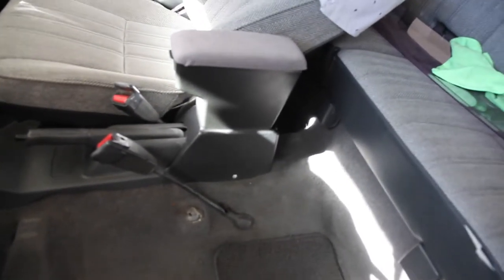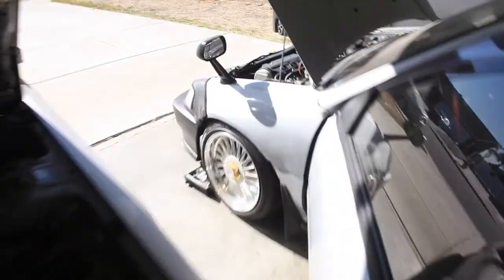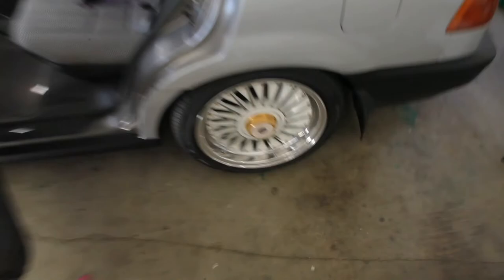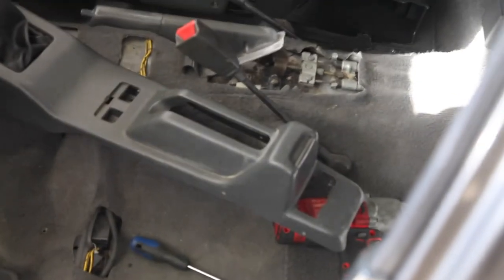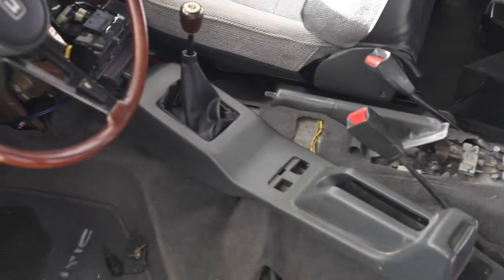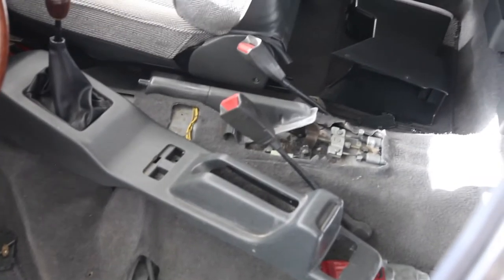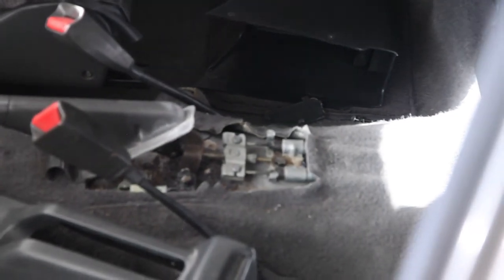Seat's out — ignore the mess. Now we've got to pull out the armrest. Underneath there should be the cables. After we get to the cables, we'll probably end up jacking the car up. We're going to put a towel around the brake booster because we don't want leakage onto the engine bay, then proceed to removing the tires. Note: if you don't have an armrest, you shouldn't worry about removing the seat at all. This is how to undo the e-brake console and access those cables, which we'll get to after we jack the car up.